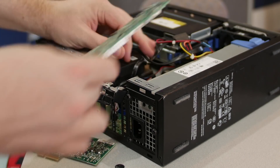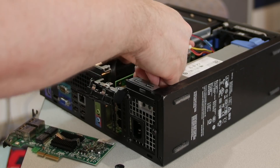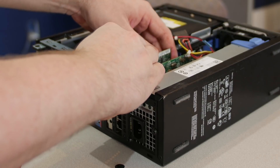If I put both cards in there, I'll have a total of seven NICs coming off of this i5-2400. Normally you don't really even need to do that. You would just run the router into another device called a switch, and for your wireless you would run it to a wireless access point. You would put your wireless access point somewhere convenient, like the middle of the ceiling, or in the attic, or somewhere conveniently located in your house.